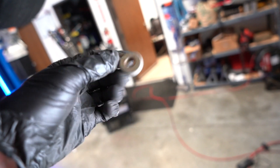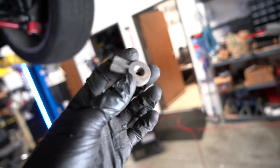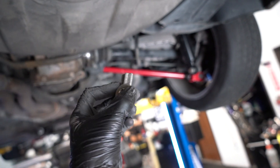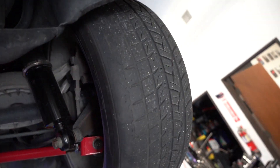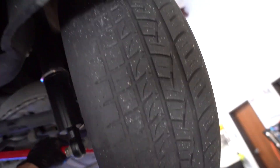When you're adjusting the camber on the car, you want the same amount of threads out on each side so one end doesn't have four inches showing and the other has none. This is the flag nut — it's a basic nut but it has a little leg to it. When you turn the bolt, the leg catches on something and holds it in place so you don't need a wrench. With the jam nuts loose on both sides I can twist the arm with my hand — that's reducing camber, and that's adding camber.